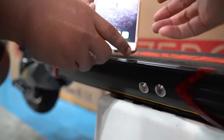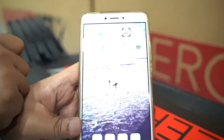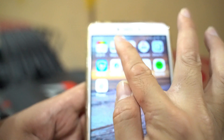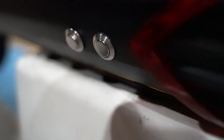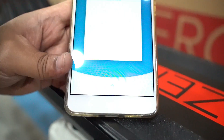We're going to show you how to program with the app. First, turn your scooter on. You'll need either an Android or Apple device. Download the app called 'MQ Con' — that is our controller app, available for both Android and Apple on the App Store or Play Store. Remember to have your programming button pressed. Then go into the app, hit Bluetooth device, and scan — but make sure your Bluetooth is turned on.